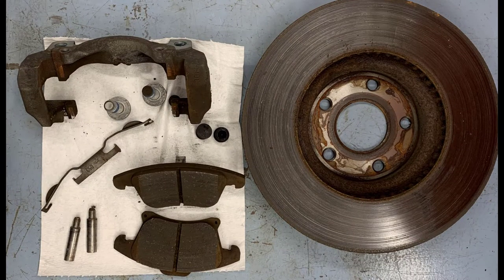We have our parts laid out on a towel on the bench in a logical order: the brake rotor, the pad support, the pad support bolts, the anti-rattle clips, slide pins, brake pads, and the little caps that cover the slide pins. I have them laid out in a way that makes sense so if one group takes these parts off and another group comes in later, the parts are in a logical manner — this is how you should be laying out your parts on the bench.